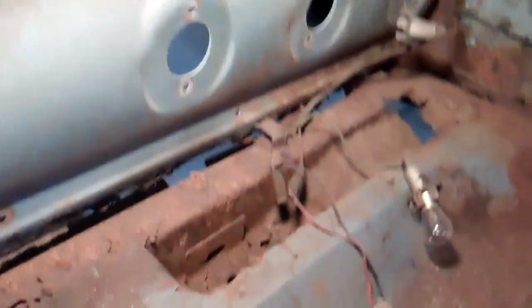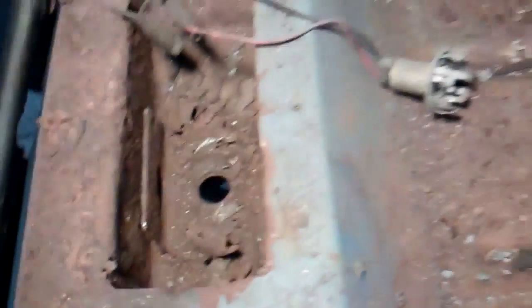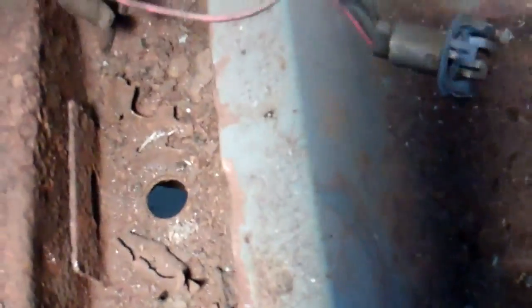So that's what the boot floor actually looks like. You can see that's one pretty rusty boot floor. So this is going to be a bit of a job in itself, but I'm going to start today, take this out. What I had to do early on when I started stripping this car down, as you can see back there, just through this rear panel, I had to cut out a section of that back panel there to get to the chassis bolts, because they just wouldn't turn, rusted in there, and I needed to get from the socket on the top of it.